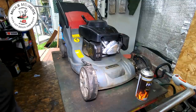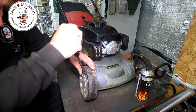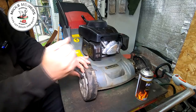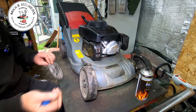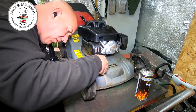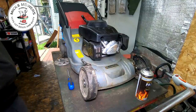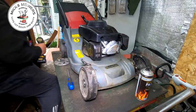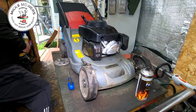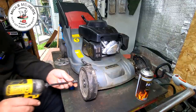It's never going to win any prizes but in the right light with a photograph taken of it, it should be okay. I'm going to remove this wheel cover because it's all a bit loose and I've got some wire holding stuff on — not quite sure what that's about. So I'll get a little socket onto that, probably about 12 or 13 mil — it's a 13. Let's put a 13 on and see what's going on with these little wheels.